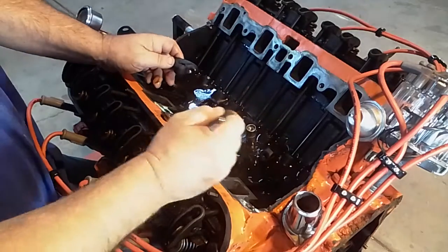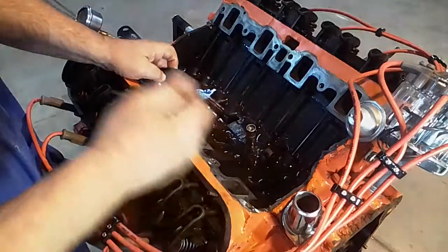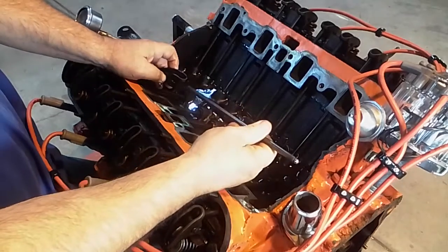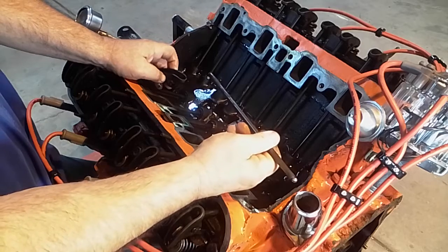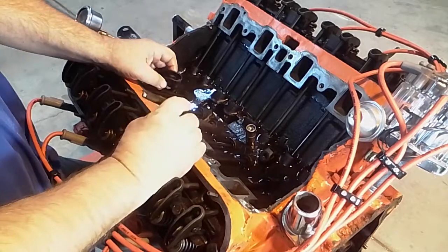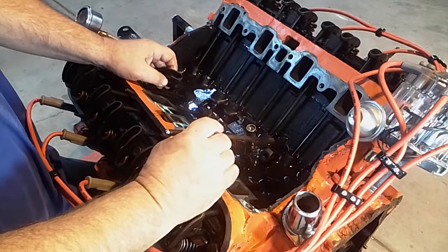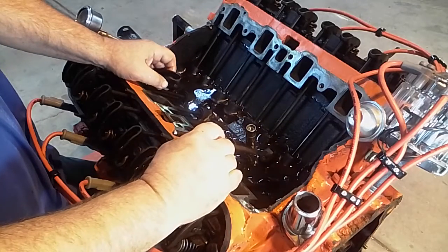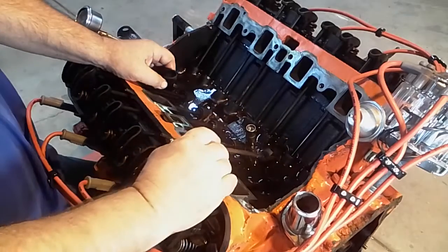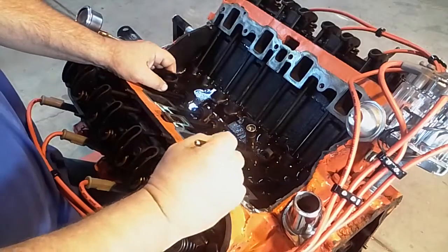You don't want to be just putting in a longer push rod. So you've got to look at what's going on and why you've got a particular loose rocker. I was just trying to say in the other video that one of the main adjustments is the length of the push rod. You need to be aware of that because you can run across them. When the factory built them, if they wound up with one that clattered just a little bit, either at the dealership or even in the factory, they would put in one push rod that was just a smidge longer so that it was nice and quiet and ship it out the door.